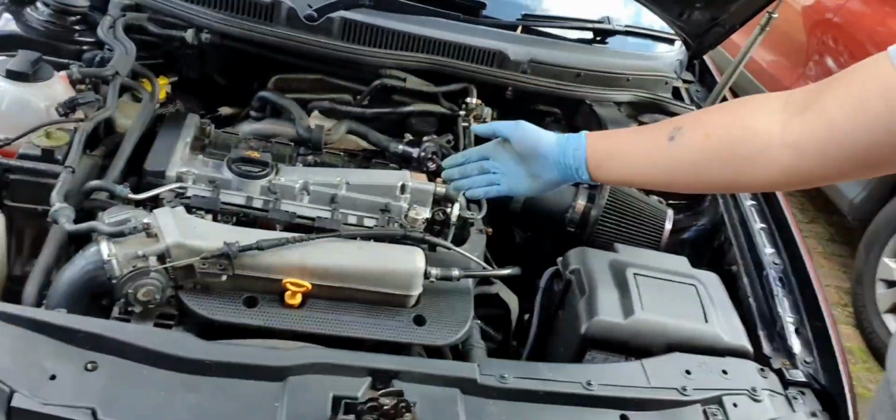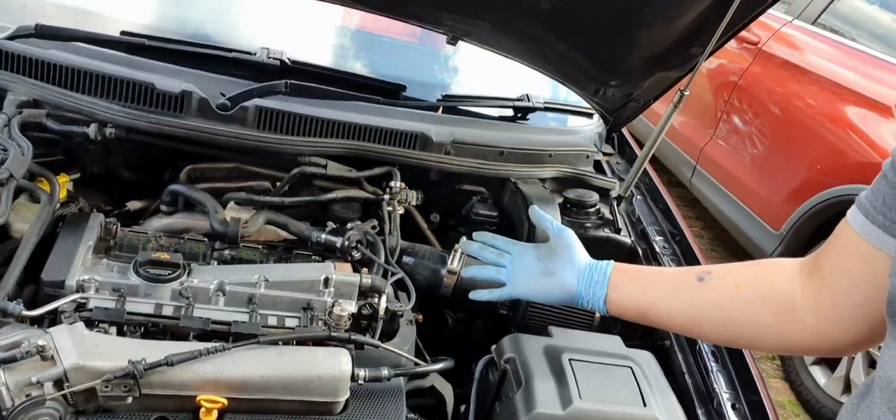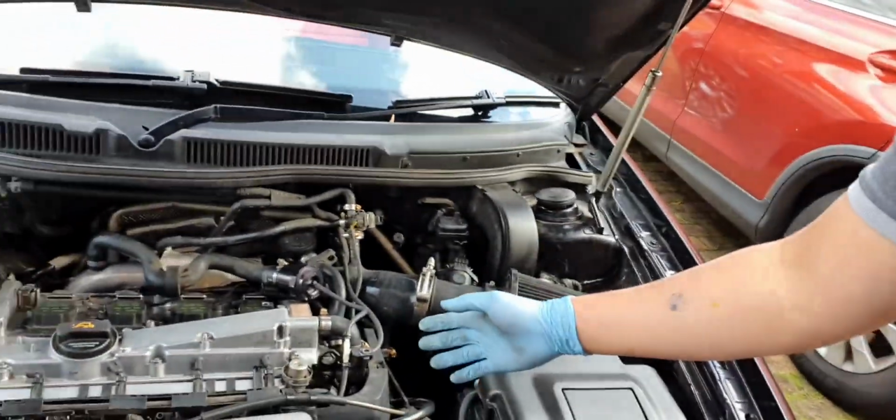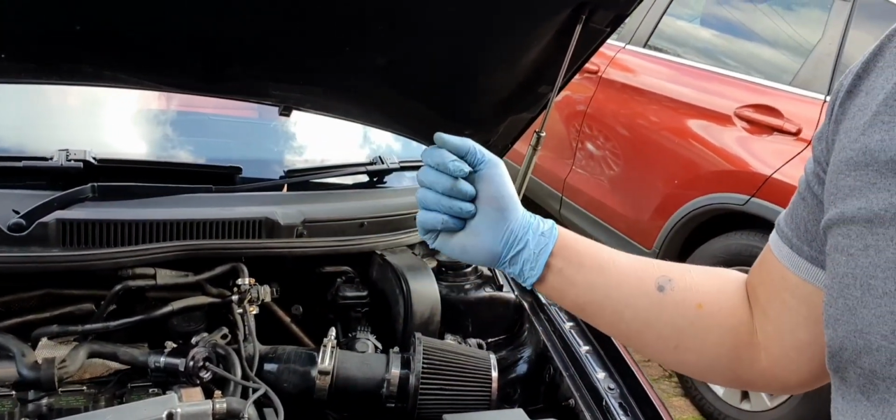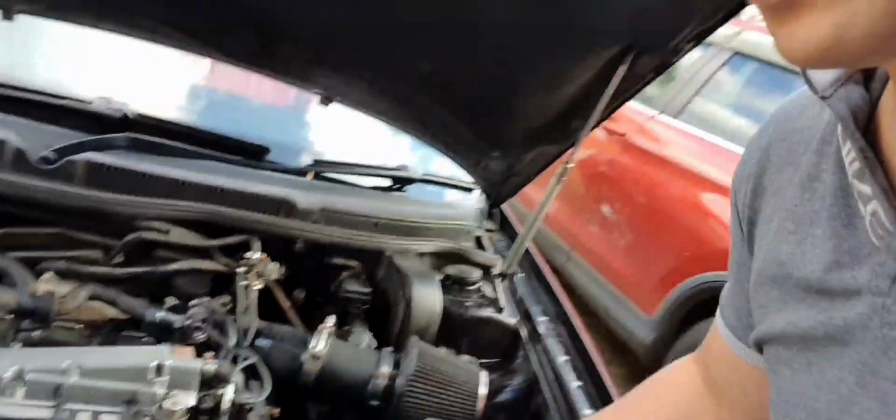Right everyone, just to conclude the video, the injectors are in. I had to cut the video before because after I installed everything and tuned the car, it gave me an error code on injector 3 open circuit, and it sounded like a Subaru, just, you know, not firing on one cylinder.